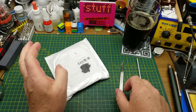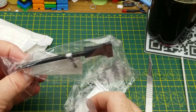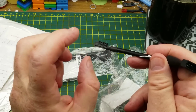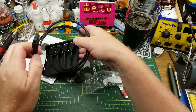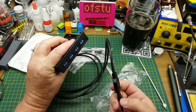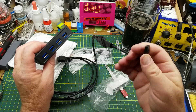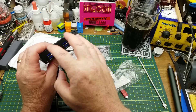Next item — I can't read what it says on here, it's too faded. These are USB 3 to USB 2 adapter cables. I remember now — this goes onto the motherboard of my shop computer, which is a little older than I thought, and this side goes to the USB 3 cables I got several mailbags back for mounting in the front of my computer to give me more USB access. I always need to plug USB things in here and just don't have enough ports. The available motherboard headers turned out to be USB 2 only.